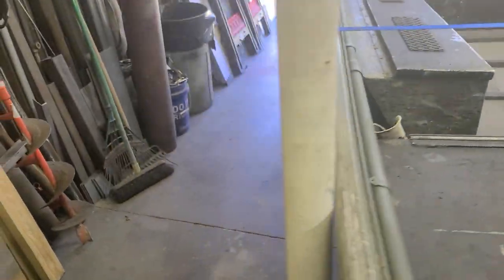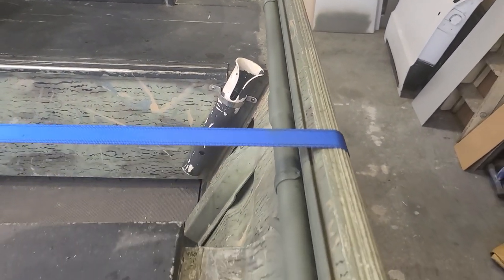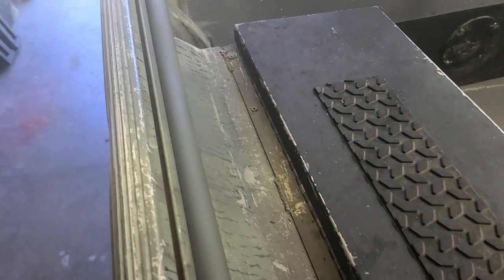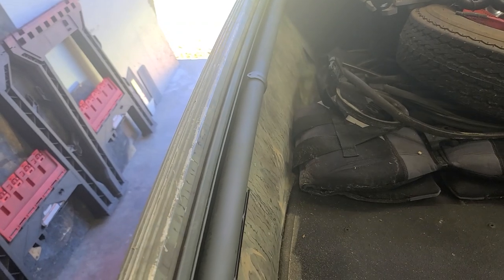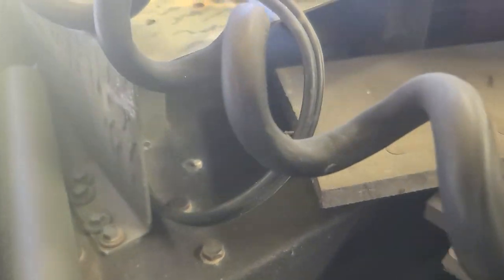Then a new six gauge cable running all the way up to the front of the boat. I asked him if he was against putting in chases for all the wiring, especially using it as a duck boat with a couple of guys and dogs tromping around. It's nice to have everything contained and safe. Regular gray electrical conduit, strapped to the side of the boat, pop riveted in - definitely well above the waterline before anybody starts asking about holes in the boat.